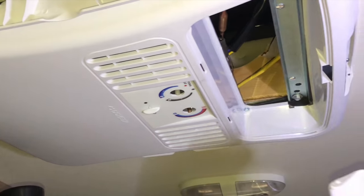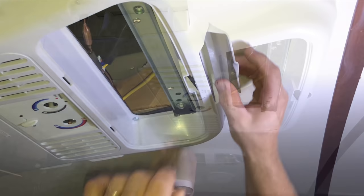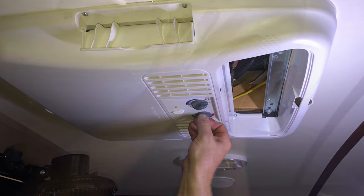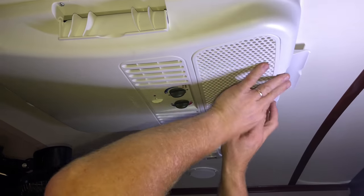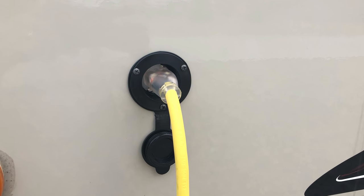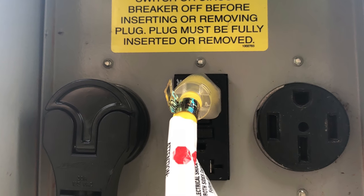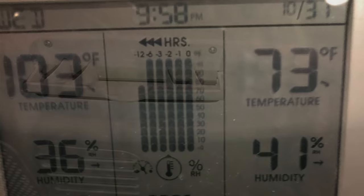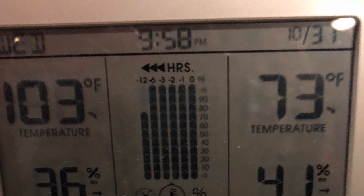There are some deflector vents that go on the front and the back — I just bend those gently and the little pin fits in the hole. Then I put my control knobs on, and last but not least I put my air filter on. I'm going to use a heavy-duty 10 or 12 gauge extension cord and plug this in. Most RV parks have a 50 amp, 30 amp, and 20 amp, so I'm using both the 30 and the 20. I fire it up and you can see how well it works — it's a hot day and we're keeping cool inside. This is how you install an additional air conditioner unit on a 30 amp RV. I'm How-To Bob, thanks for watching.